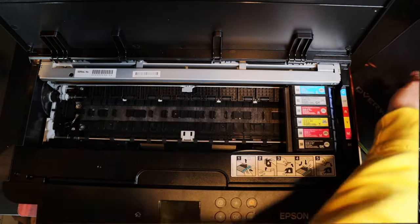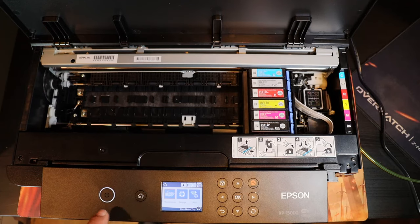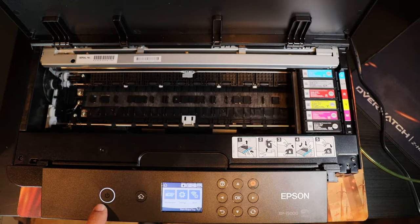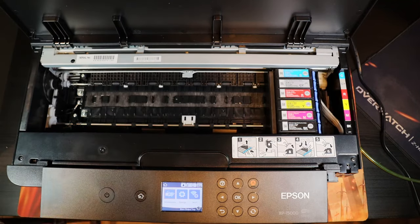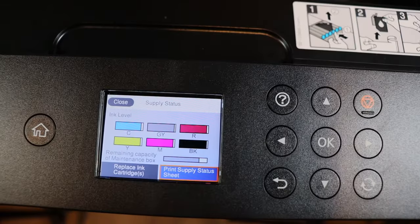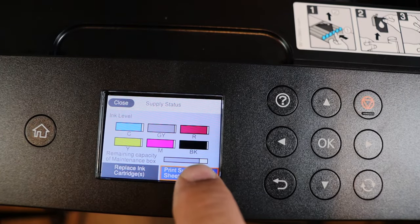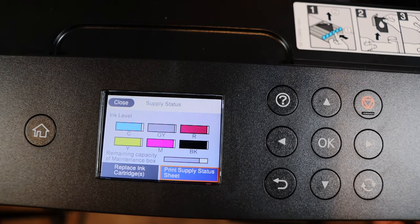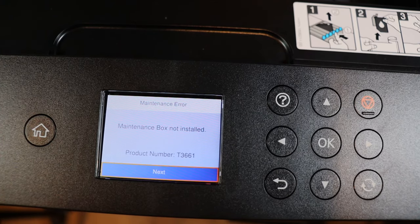Now that we're ready, we're going to go ahead and turn this printer on. The printer's never ready until this stops blinking. When you have a solid ring light, that's when the printer did all the tests, passed all the tests, there's no codes, and you're good to go. Now you can see that solid light — that means we're good. We go up and hit our ink status — it's going to give us our inks because we haven't done the chipless software yet. We are going to be tracking that right there. Don't ever let it get near 15%. As soon as you see that at half, you're going to remove the cartridge, and we're going to reset — because if we let it get too low, then we're going to lose that tank.